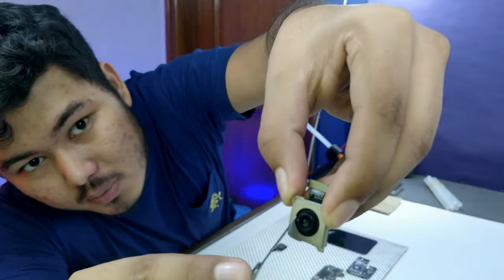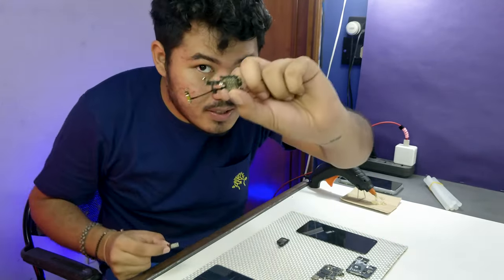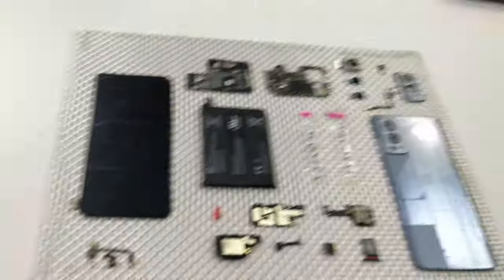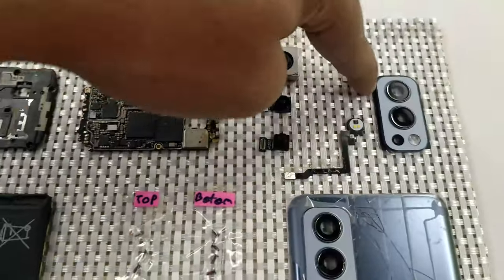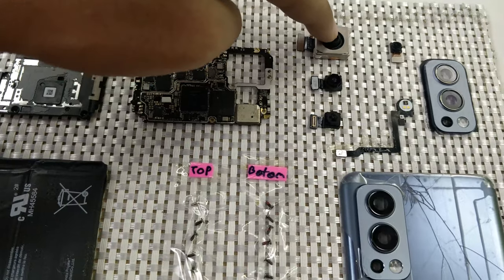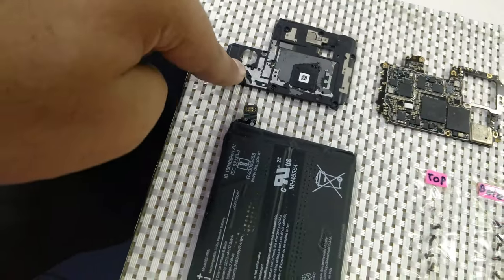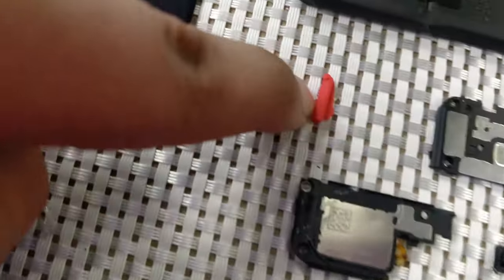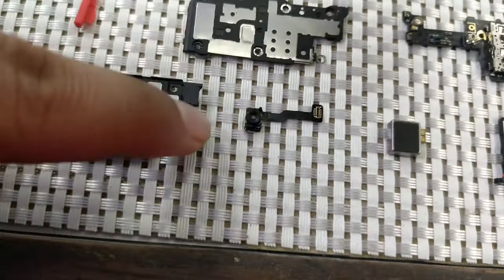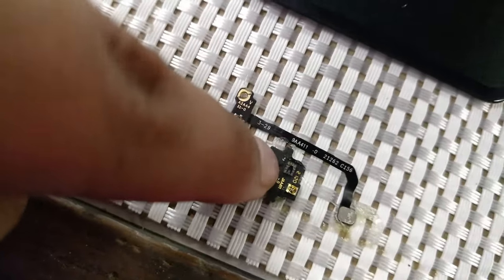This is the main camera unit — we call it OIS. This is our bottom-firing speaker, this is the SIM card tray, and this is the SIM card. This is our in-screen fingerprint scanner, and this is the back panel. Flash, front camera, rear main camera with OIS, second camera, third camera, bottom screws, top screws, main motherboard, motherboard protector, the main battery unit — the screen unit will be saved — secondary board, SIM tray, haptic engine, front fingerprint scanner, secondary board protector, main loudspeaker, Wi-Fi band, Bluetooth band, and our main screen.